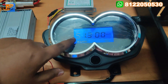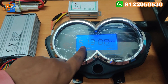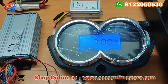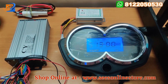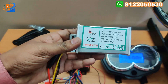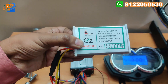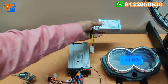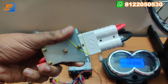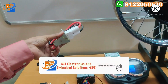The next thing is the fully digital speedometer coming with the CVZ brand — this is a full-option display where you can display battery voltage, indications, kilometers, left and right indicators, and more. One speedometer can be used for the whole vehicle. Next is the DC-to-DC converter to convert your 48V/60V to 12V, used for headlight and horn applications, coming with CVZ brand. The final thing is the battery socket to connect your lithium battery, with both male and female connectors provided.